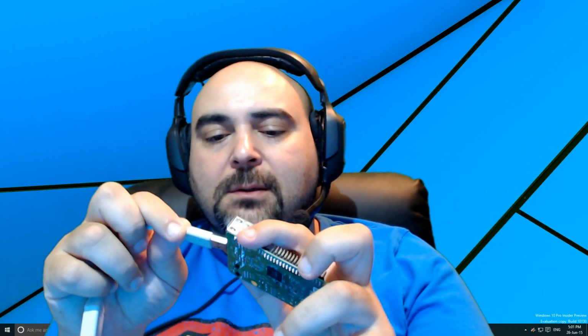You also need an HDMI cable, of course, to connect the Raspberry Pi to your monitor or your TV, where you're going to do all your retro gaming. And you should get an old keyboard and a mouse, a USB keyboard and mouse, like you can see here. I have this old keyboard and this old mouse, which in my case have a PS2 connection, but my secret weapon is this adapter. I'll put the PS2 here, and I have the USB here. And all this will be connected to my Raspberry Pi USB ports, like this. That's for the keyboard, the mouse, and the Ethernet cable.